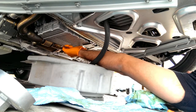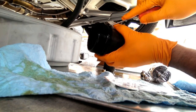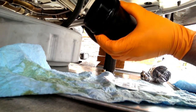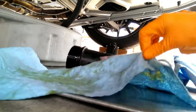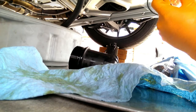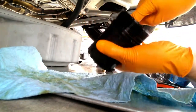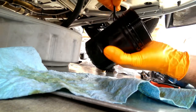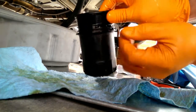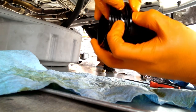A little bit of a check — done. Wipe it off. Find a little ridge. Take the pick and flop that out. Pop that new one on. Just take my greasy fingers, grab a little bit from in here, and move it up. You don't want to damage the seal as it's going on down the threads — it's got to go into that big groove. There it is. Clean all the way around.